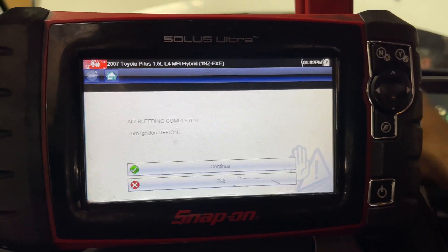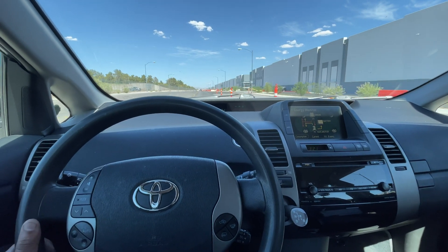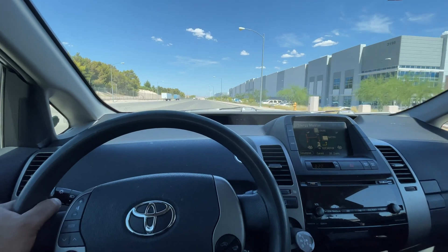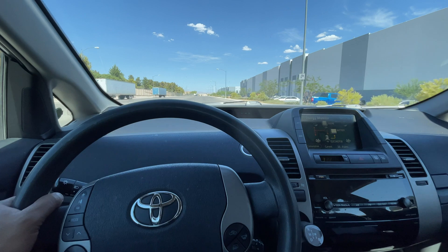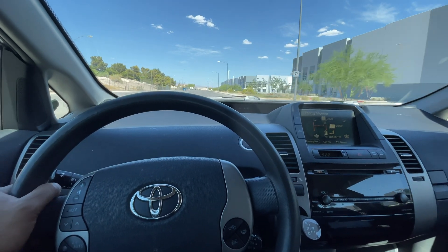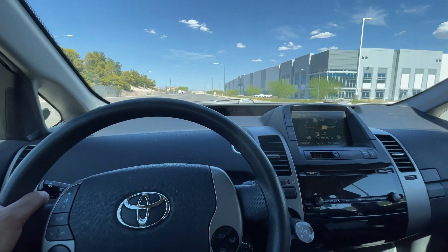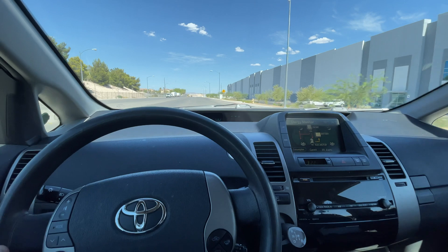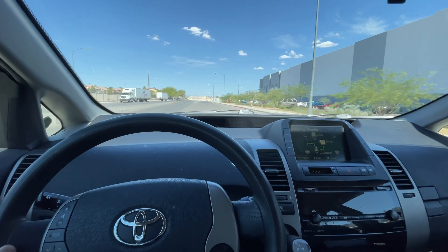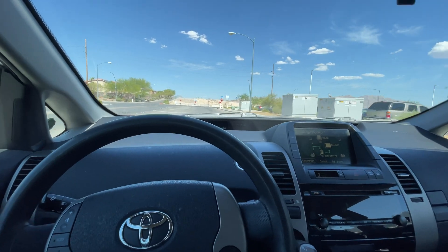Let's take this for a test drive. Out on the street now — this thing's driving pretty good, brakes feel great. Just some final thoughts on this job: this is not really for DIYers just because of the scan tool stuff that you have to do to bleed it. I guess if you have a really good scan tool and you're a DIYer you could do this on your own, maybe with a helper at home, but this is more so for technicians. Anyway, that's how you do the ABS modulator and ABS control unit — thanks for watching.